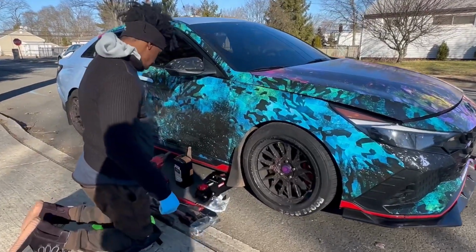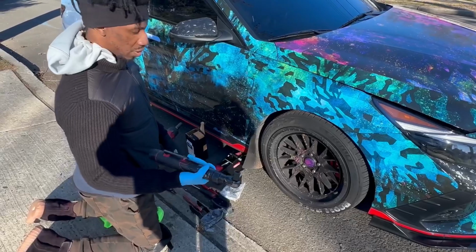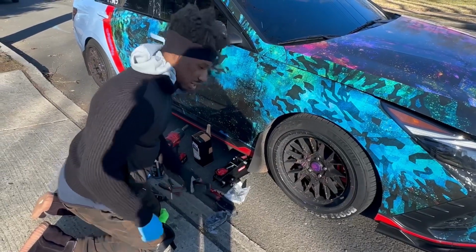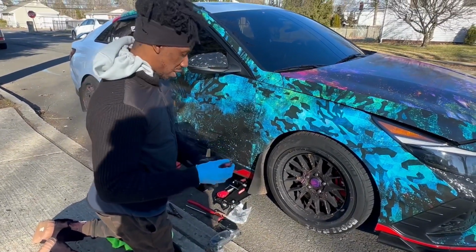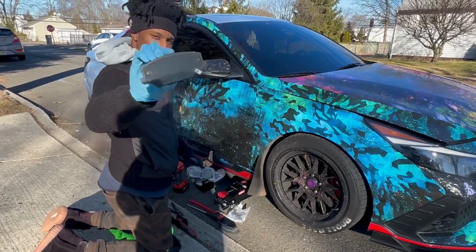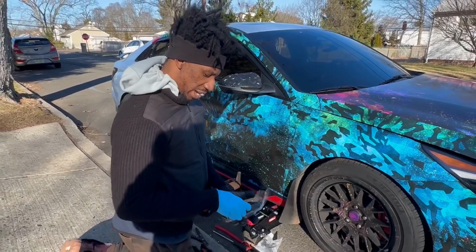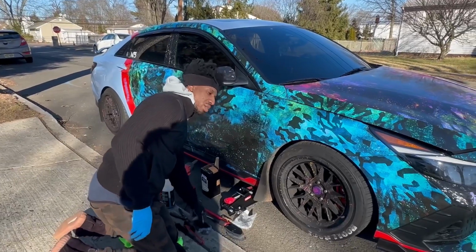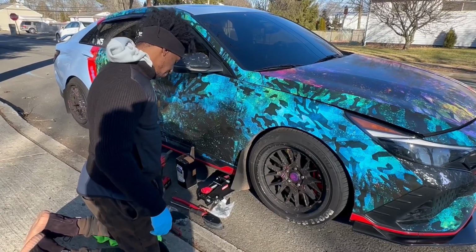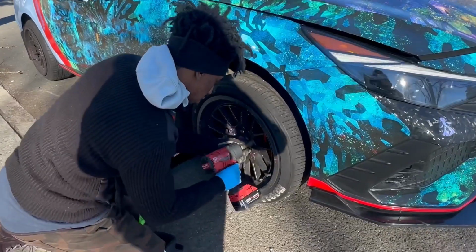For this job, you're definitely going to need some gloves. You're going to want a 3/8 or half-inch ratchet with a 14 for the two back caliper brackets. You're going to want either a C-clamp or one of these little tools that I got from Amazon. I'll leave a link in the description. You're going to need your brake pads. These are the brakes that you need. Remember that sizing. These brakes are from a 2019-2021 Performance Pack Veloster N, so it's the same brakes. Those are the ones that you're going to want. You need a flathead just in case you want to get these lug nuts off.